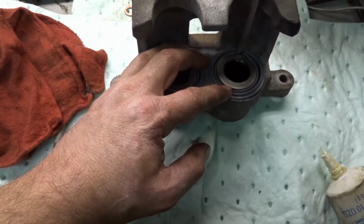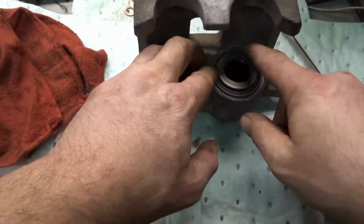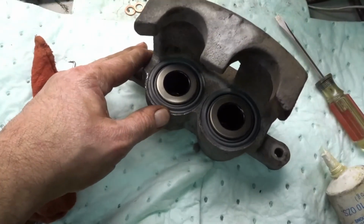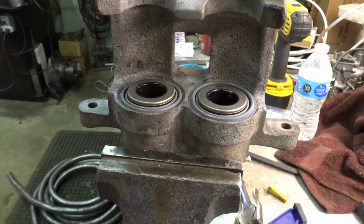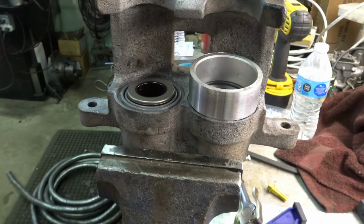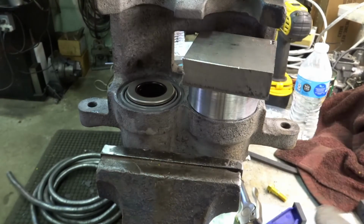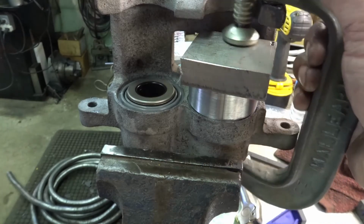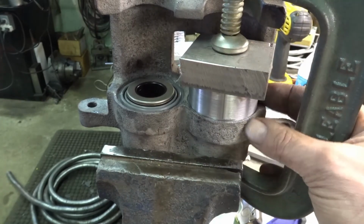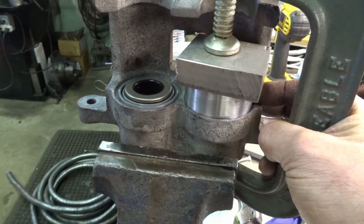And we'll push the pistons out again just to verify that they did seat down in properly. But a little bit of tapping around there, and those seals will be in. Here's a shot of how I pressed in the dust covers. The advantages of having your own tools is I spun that out on a lathe real quick. And boom.